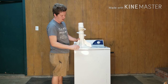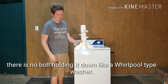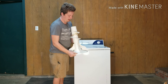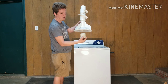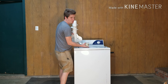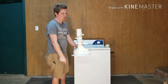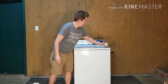On these agitators — they're a Whirlpool-type agitator — you'd normally take the little top off and undo it with a seven-sixteenths socket. But these don't work that way. You basically just reach in, grab on, and give it a nice pull — it just snaps in place over a little piece. Sometimes it'll be really stuck and you'll have to put a bar across and use a ratchet strap to slowly ratchet it up until it pops loose. But most of the time you can just manhandle it a little bit and make it come up.